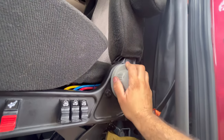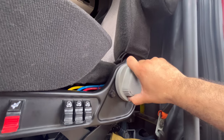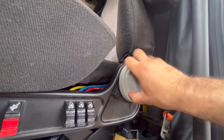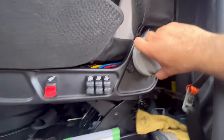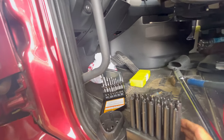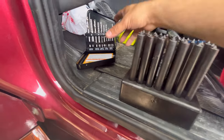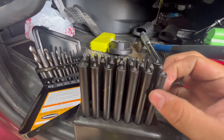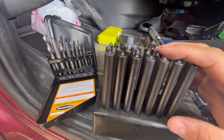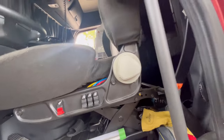I did not know how to get that piece out. Even though I do a lot of things, I was going back and forth, and my wife said 'why don't you just get a drill and get it out?' — hey, that sounds like a good idea, never thought about that. But a regular drill was not going to do it, so I did have to buy this kit. This one is called the transfer punch — you use it to poke a hole in the middle so the drill bit doesn't wander around. My tools ended up being more expensive than the part itself — this one was about twelve dollars and this one was about twelve dollars. Good tools to have. Hope you enjoyed this video, take care.